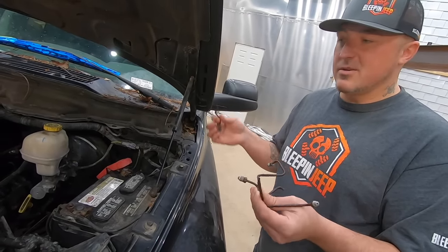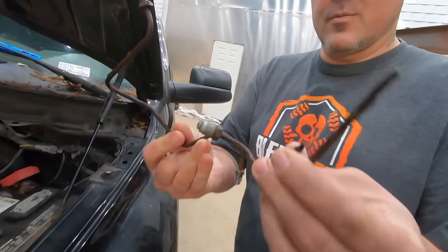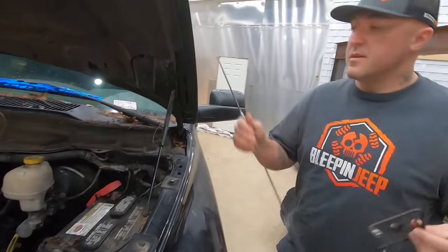So when I drove this thing back from Pull Apart, we had a serious issue with the brakes. They were chattery. I didn't know what was going on. Get it back here. And this is our brake line assembly going to the anti-lock brakes. So the first thing we're gonna have to do is make some brake lines.